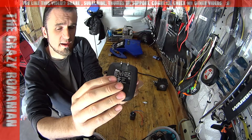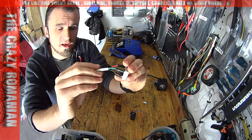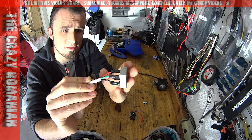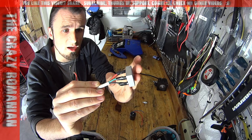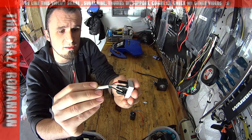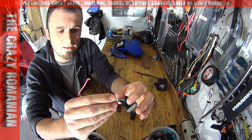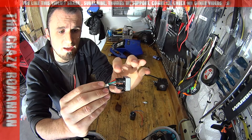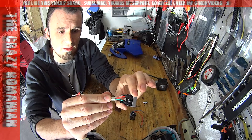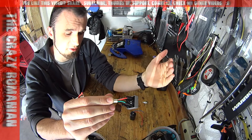This is my AC adapter — I'm going to plug it in, and then I have a rectifier. If you're not familiar with how a rectifier works, you can find these on Amazon for about $5 shipped. What they do is convert the current from AC to DC. There are two terminals — green and white in my case, clearly marked — these are the input terminals where you input the AC current. Then the red and black terminals, also clearly marked, output direct current instead of alternating current.